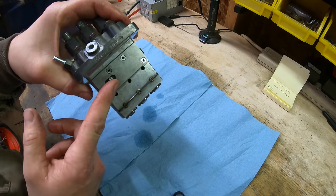Testing confirms fuel is coming from all three delivery valves — initially only one delivered at a time, but blocking each one in sequence verified fuel flow from each. For the stop valve test, because diesel was spraying around the shop, the camera is briefly turned off. The test is performed off-camera using a wire tied to the stop lever to hold it closed while cranking.